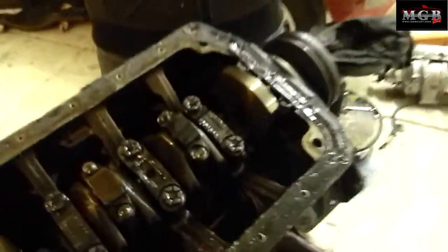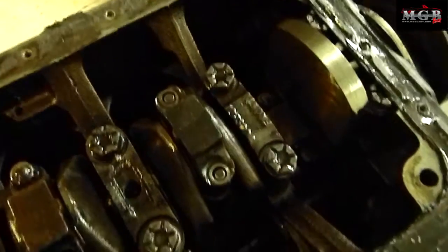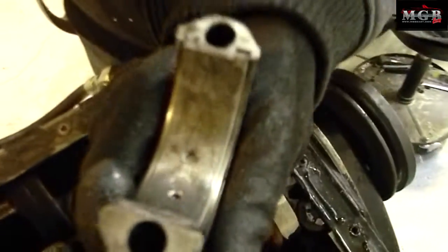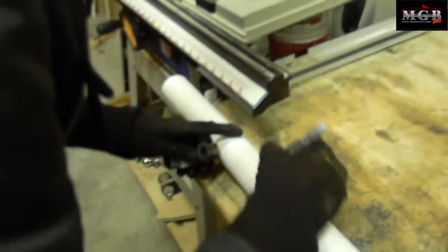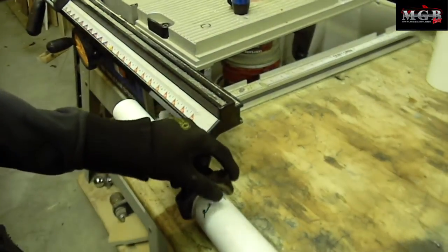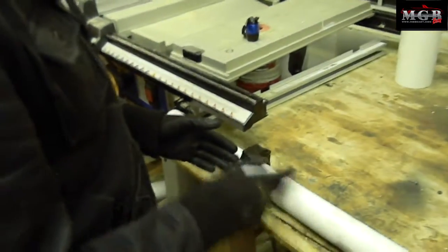One way to get these off is to tap them with a hammer — and there you go, that was easier than I thought. Then you can see the bearings. I just took off the number two piston and I'm going to label this cap 'F' for front and '2' for what number it is, then set it right where that one is. You can do that for every single bracket.